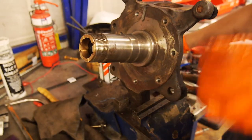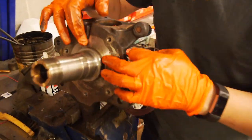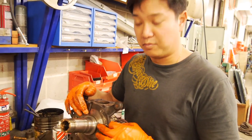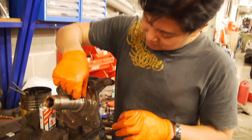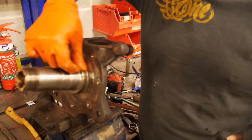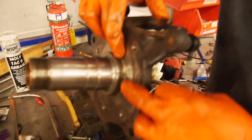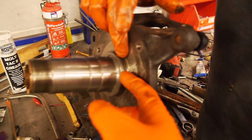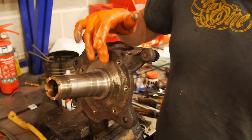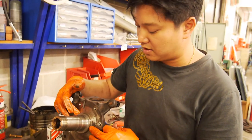I'm going to just remove that lip there and rework it a little bit — get some emery, a little bit of lubricant, and just like this. I don't want to take too much material off, but just take off that little lip there. Visually you can see it, but the high step from that worn edge is mostly removed. This area here is where the axle hub seal will run — you can see it's full of gunk. Once you clean it up, you'll see that line where the existing seal ran. They do sell replacement spindles for that reason, but if you just want to resurface it, you can get a speedy sleeve that'll go over that.